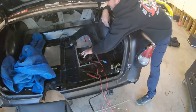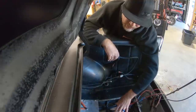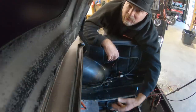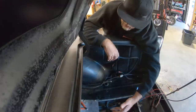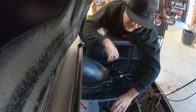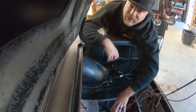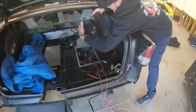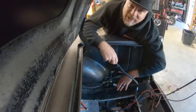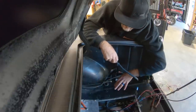My issue was I had the non-brushless version of that module in there, and because I was running E85 fuel, and because we had a rich tune-up in this motor, and because this motor's hungry, that was not nearly enough fuel pump. So after drag week, I stopped at Bowling Green, Kentucky, got the brushless version of this module, quickly zip-tied the controllers into the car here, just ran the wires real quick, made one hit, discovered everything was now fine. We have plenty of fuel pump.